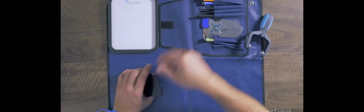As AJ said, I'm Ed Waldrop, the master technician with iCracked. Now, I've been heating this phone to loosen the gasket that goes between the display and the frame. So I'm going to go ahead and pull this off. I'm going to remove the two pentalobe screws located both left and right of the charge port. Wow, those are really long. I'm going to take my trusty iSclack here and begin to start separating this. You see the bezel starting to lift up. I'm going to take a little plastic tool here, get in here and cut that gasket along the edge.